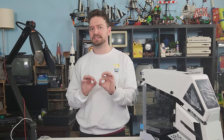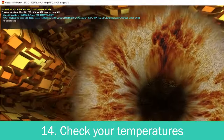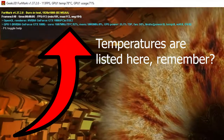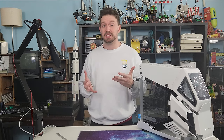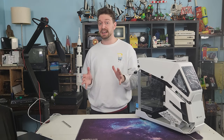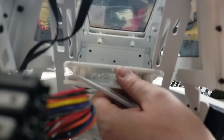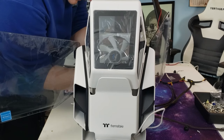Once your PC has survived a CPU and GPU stress test unscathed, it's time to look at the temperatures. Furmark tells you in the top-left corner what the temperatures are. If you left it on long enough for everything to reach maximum operating temperature, look up your CPU and GPU to see what is an acceptable operating temperature. If you're exceeding that, you need to reconfigure your cooling — make sure fans aren't obstructed, tuck some cables away for improved airflow, or add more fans.